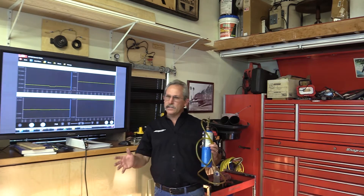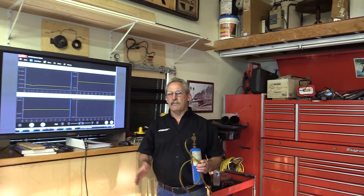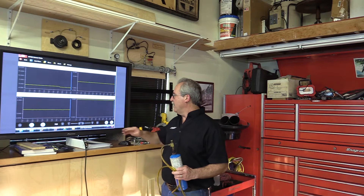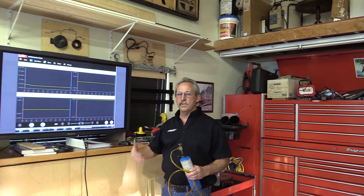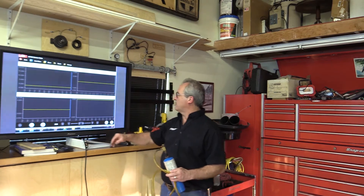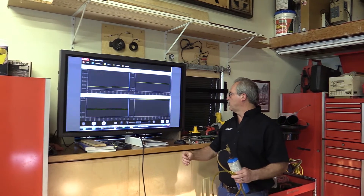If it's between 2 and 7 seconds, it's questionable — depends on manufacturer. If I'm over 7 seconds, I'm pretty sure the converter is not my problem. On the screen I have time flying by in frames per second, so I need to know how many frames per second because frame rate varies by vehicle. I can pick a point to start counting, use a stopwatch on my cell phone, or go old school.